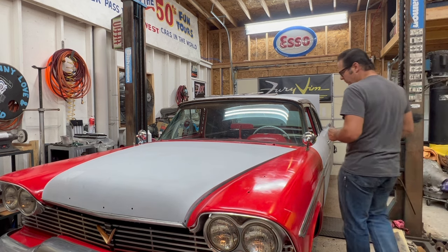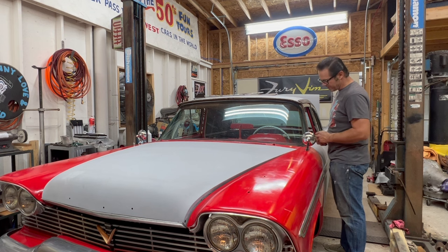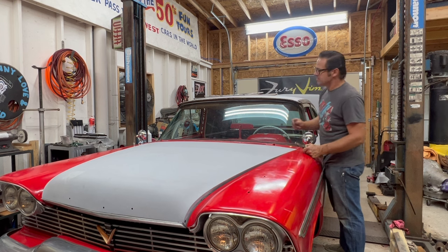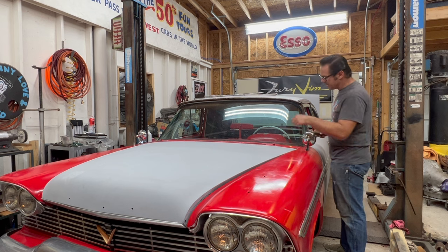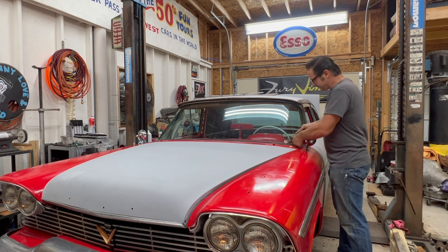On this episode, we are going to remove this windshield, which has a bullseye and some crazing. Unfortunately, in this case, this gasket will not be reusable. It is quite petrified and has several areas where it has cracked due to shrinking. So it's not pliable enough to unlock. I'm going to move forward with hopefully just cutting through and shattering it out of the way to get this windshield out. So let's see how that's going to go.